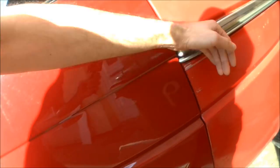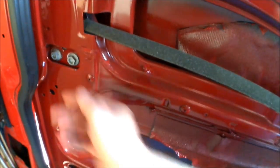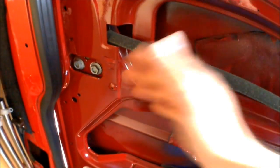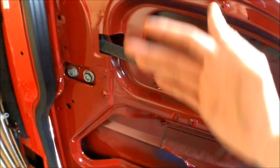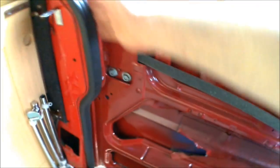Now if it's actually sticking out or sticking too far out, there's two bolts at the back. You obviously need to take all of your interior panels off, and those two bolts — you unscrew those and there's a little bit of movement and play, both up and down and back and forth. Ideally you do need a second person, because if they can be pushing it from the outside while you're tightening it in place, that will adjust the back side of the door.